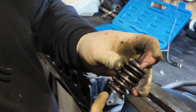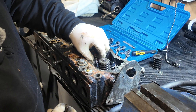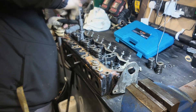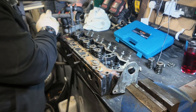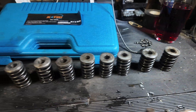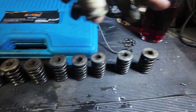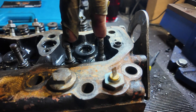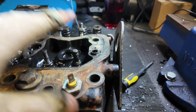Put these back in the same place you removed them from. You can see how the valve is now loose — if we lift the head up we can drop it out the bottom. Inside here we've got the valve seals, but we'll get to that in a second. We've got all springs, collets, and caps out. I'm going to put a hole in these and cable-tie them in the order they are — front of engine and so on — so we know exactly where everything came from, same as we did with the push rods.